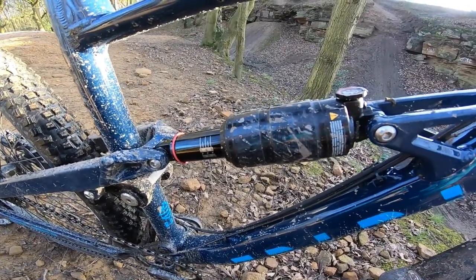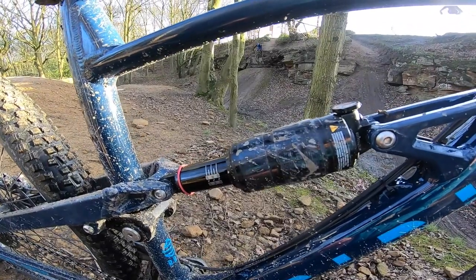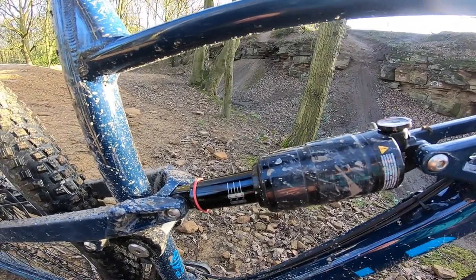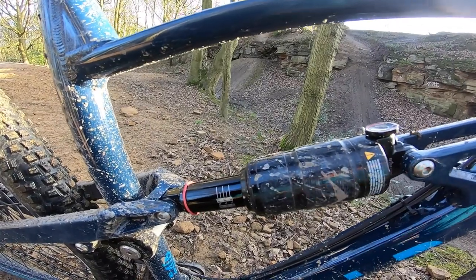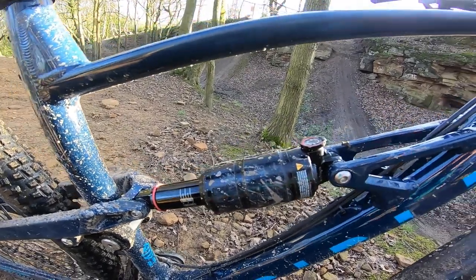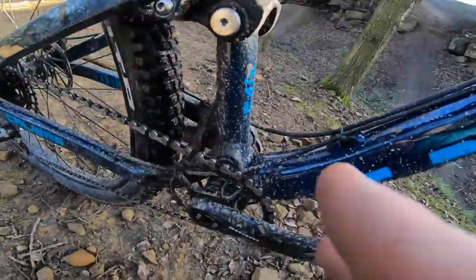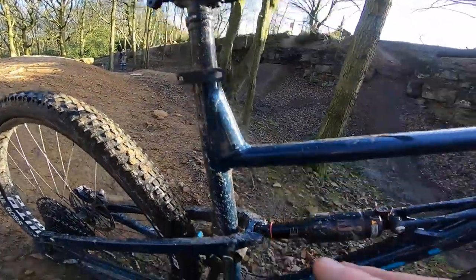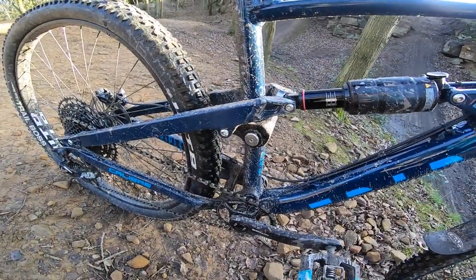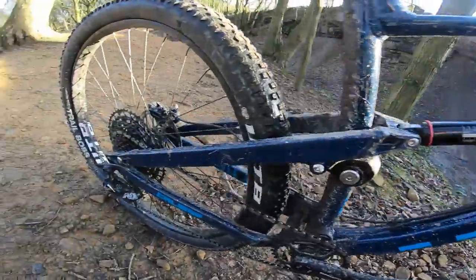Because it's a simpler circuit, you get really good high-speed oil flow, so it gets right to the end of travel on drops in a really controlled way. It's not amazingly plush, it just does the job well. You've also got external cable routing for brakes and gears, while the dropper post is internally piped — neat where it needs to be. External routing is actually easier for servicing, like bleeding the rear caliper.